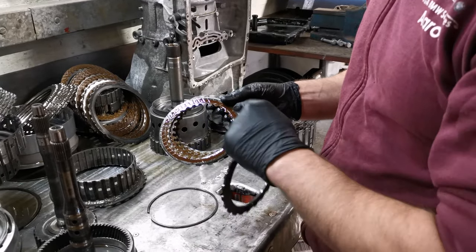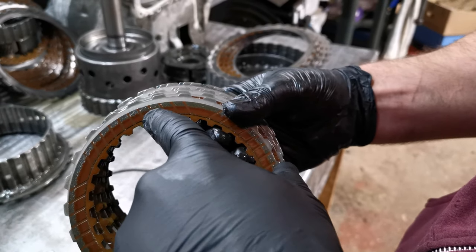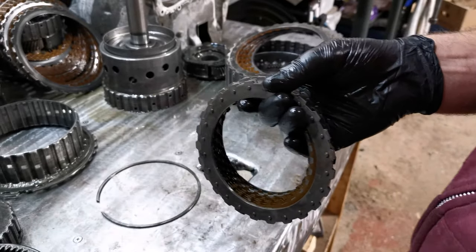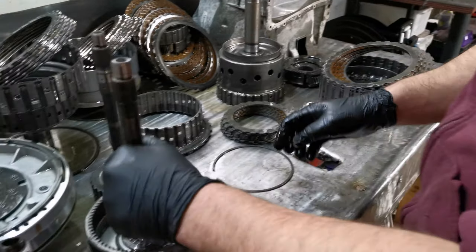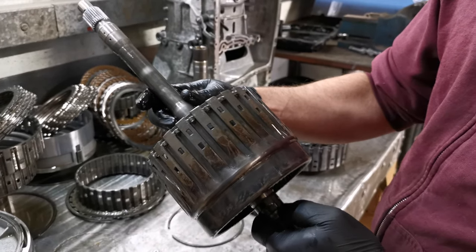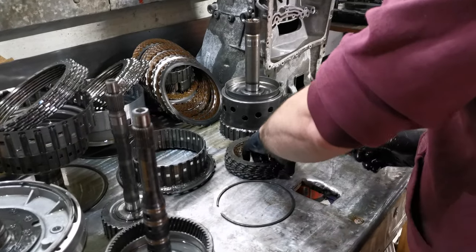Now, this very first disc, you can see the wear, this grey section around the outside of the disc, and you can also see this dark red-brown section just on the edge there. The darker section is actually a heat ring, and this lighter grey section is because the E clutch is able to sort of float as it is coupled together. This is the input shaft of the gearbox, and this is the E clutch output. They sit together like so, and it's able to flex like that, and it's not supposed to be able to, which is what's caused that ring of wear on that first disc.